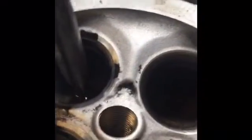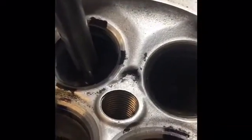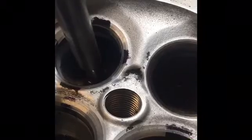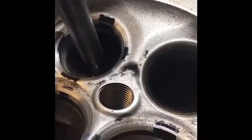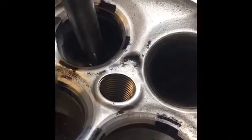And one thing that concerns me a little bit, if you look there, all of our 45-degree surface does not look like the grinding stone, just moving it by hand, removed it. So we'll go ahead and place it on top again. And what we'll do is rotate the grinding stone 180 degrees, and then spin it at that 180 degrees just to see if we have a low spot in our grinding stone, which is very possible.